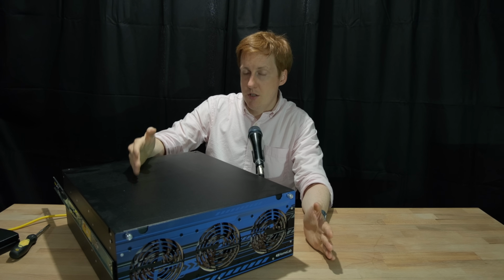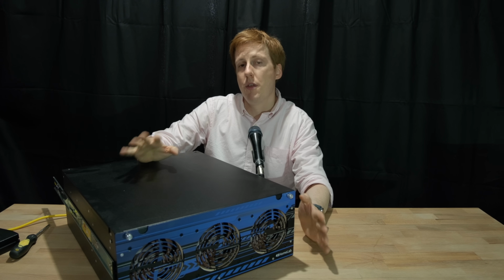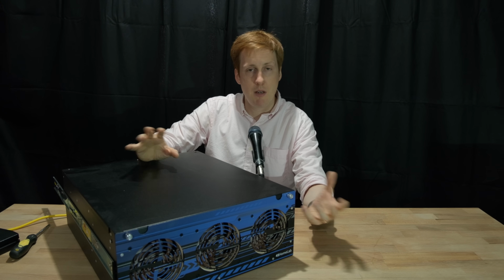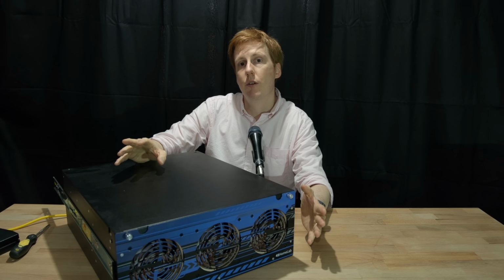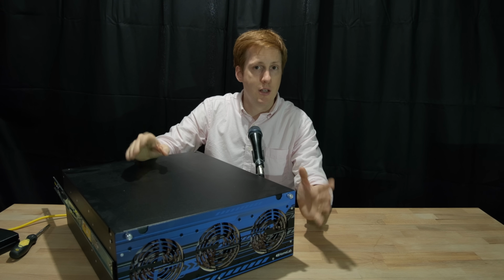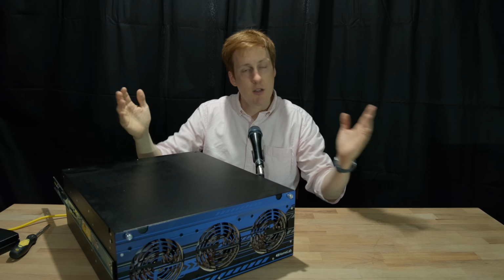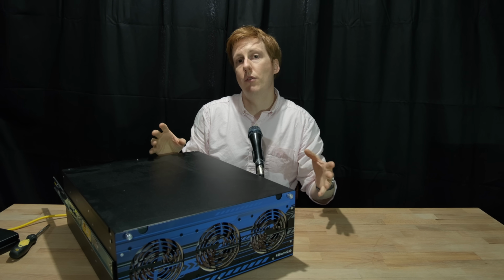I'm going to add a discrete GPU in here because this processor doesn't have a GPU. That's going to enable things like transcoding, etc., and hardware acceleration for basically anything graphical. And then I'm probably going to deploy a virtual machine on here just to take advantage of that. I might also put in things like an HBA, because whilst this does come with one, a device that you get off eBay, a secondhand gaming machine, is not going to have a host bus adapter that you can pass through. So we'll also have a look at doing that.